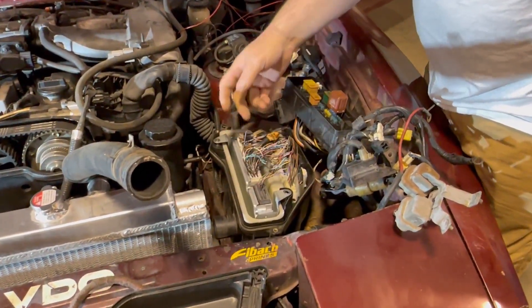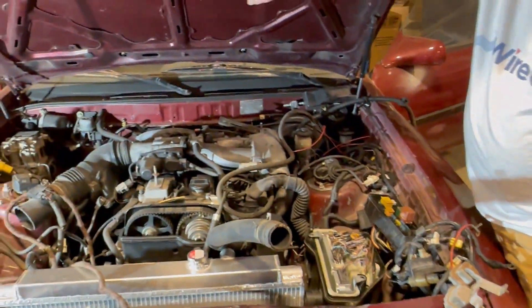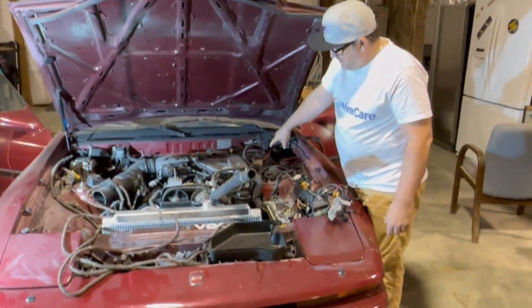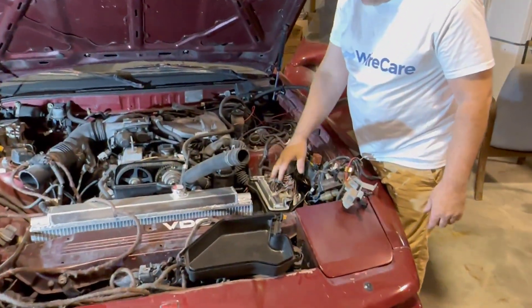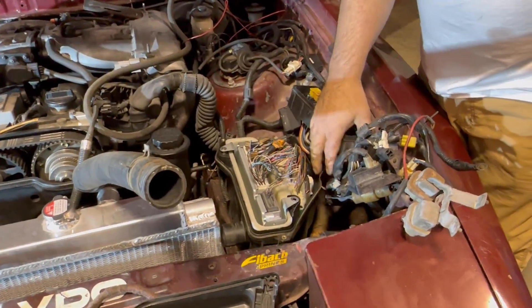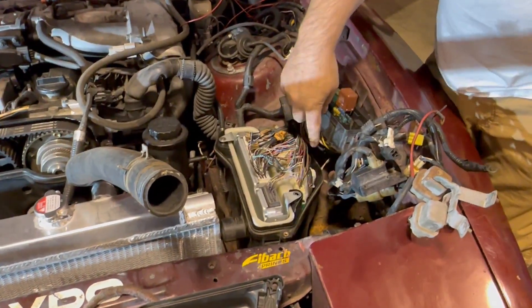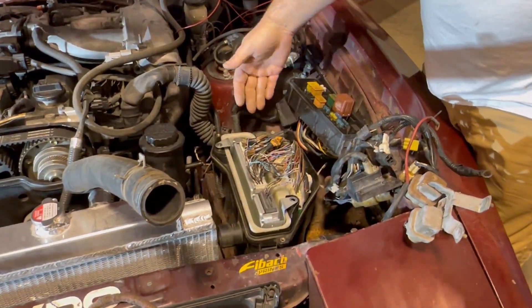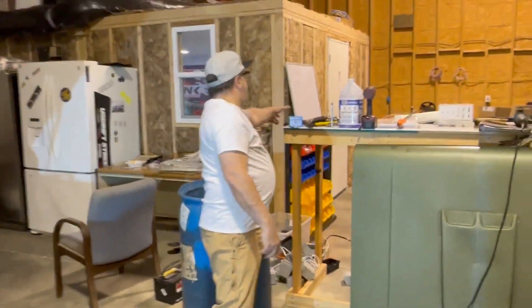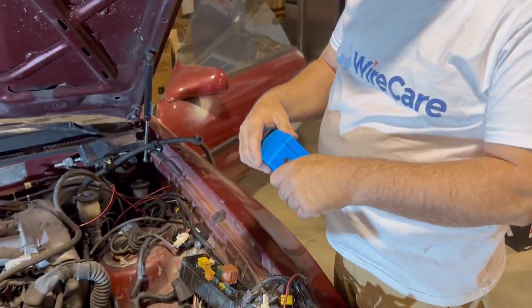What we're going to do is run all the power wires through the harness inside, routing them through here. We also took out the connector block which handles all the power feeds — that keeps things cleaner. We have the other side of those connectors so we can hook up gauges and stuff like that. We also made a couple of custom fuse boxes, and we can make these to any size we want.